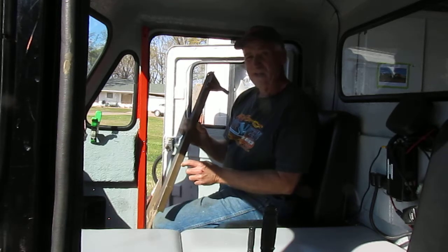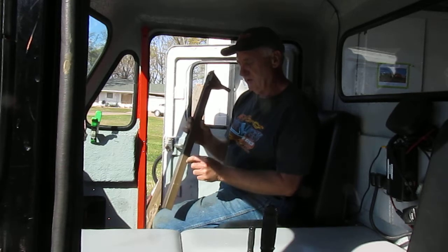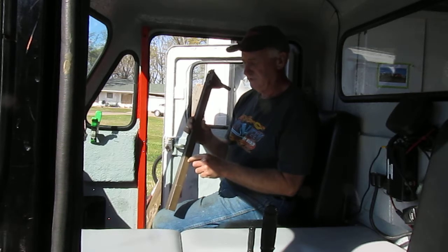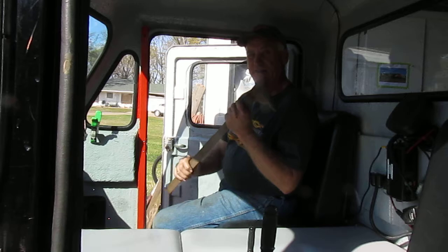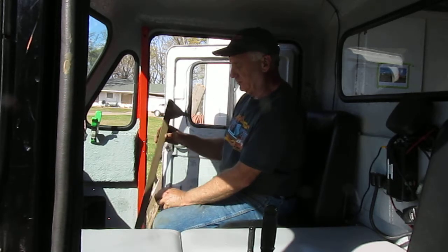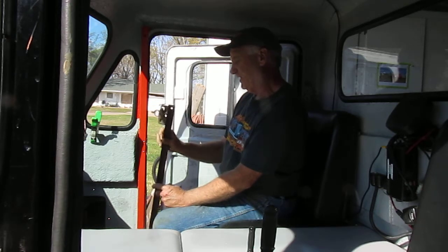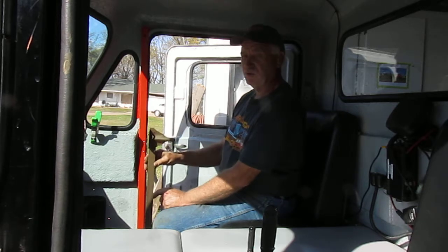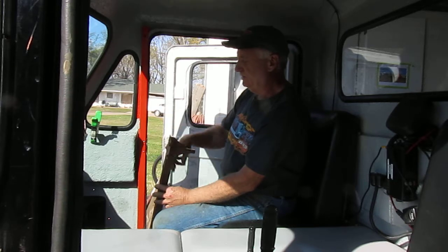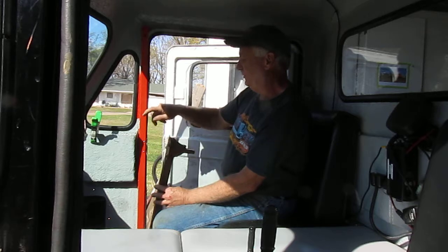And the reason for that is, it's not just that it's steel and it's cheap or nearly free, but it's not mild steel. It's a hardened steel. If you ever take an 1/8-inch drill bit and try to drill through here, many times with an inexpensive drill bit, it'll dull the bit before it drills through because it's so hard. And hard means that it doesn't flex, has strength but not weight. And so I think you could probably get the strength from this 1 1/8 by less than 1/8 thickness. You probably could get the same strength as you would from a 1/4-inch mild steel. And you wouldn't be able to find 1/4-inch mild steel in these smaller sizes of angle. So bed rails work good for a lot of things, and this in particular is one.